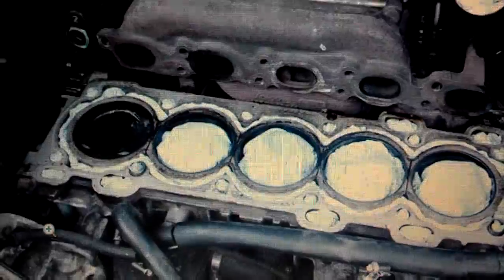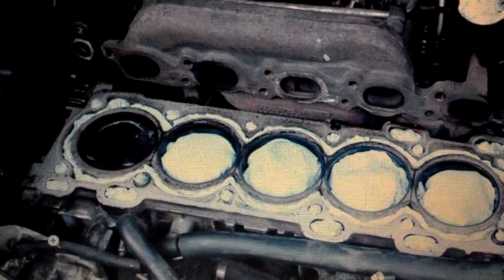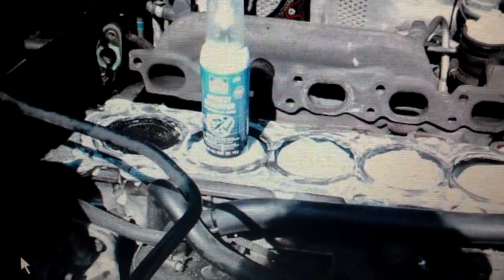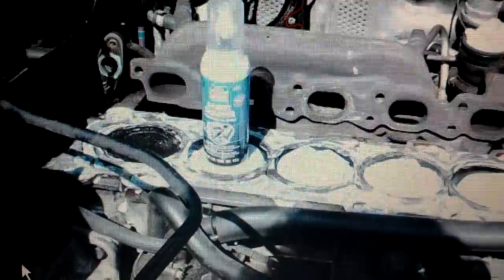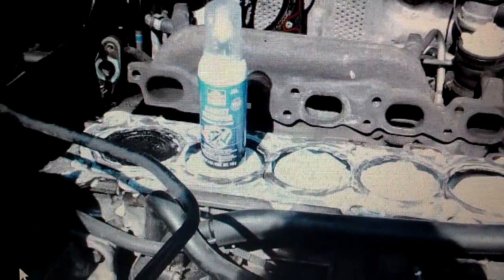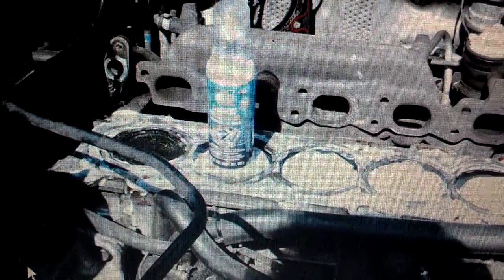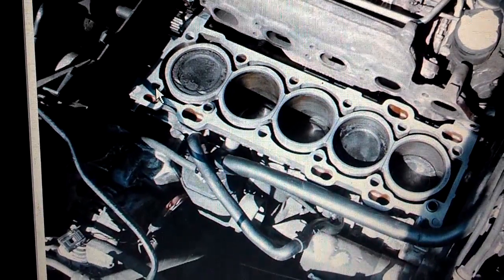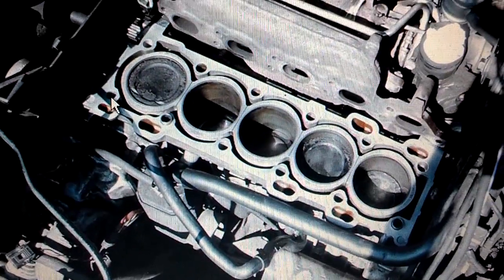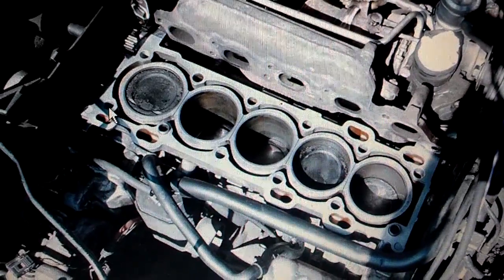This shows me stuffing the piston areas, coolant passages, and oil ports with blue shop paper towels. Take your time, make sure everything gets cleaned up real good — use gasket cleaner, remover, and other chemicals, but don't use anything that'll damage your block. Once the block is clean with everything removed and dried out, vacuum out any remaining debris. If you plan on replacing any timing components or your PCV system, now's the time — you've got easy access to all that stuff.